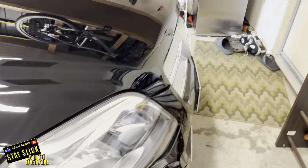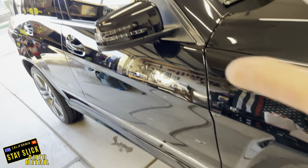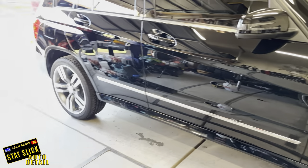I'm specifically going to focus on the hood of this Mercedes, different ways you can polish. I'm actually going to do a two-step on this vehicle, but the same thing could be applied for one step — it's just you're using an all-in-one product instead of a compound and then a polish. We already washed this, decontaminated it, did an APC rinse, did an iron remover on the wheels and all of the paint. Everything is ready to go, it's squeaky clean. We don't need to do any clay bar because I keep this Mercedes pretty clean, washing it every week and keeping it maintained. Stick around and I'm going to teach you the way I was taught to get started in polishing.